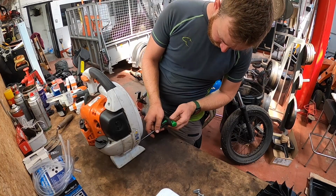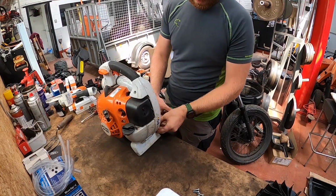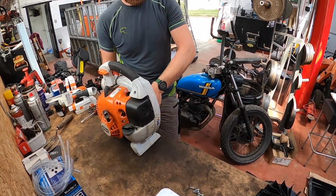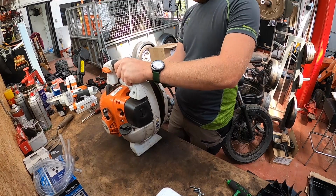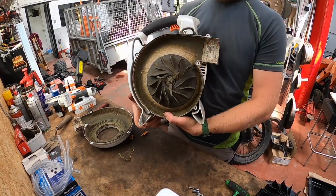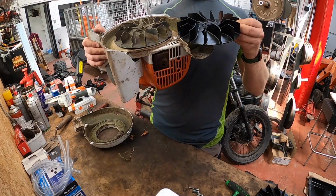Normally change these shredder blades depending on the season we're having, because we like to suck up pretty much everything, even sometimes suck up grass edges just to speed up the process. So obviously when you're sucking up grass and soil and whatnot, you're going to wear them down pretty fast. Just comes off. So as you can see, the difference, let's take it off, I can show you a side profile, but the height difference is pretty impressive.